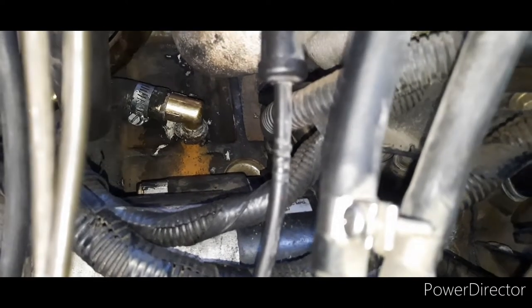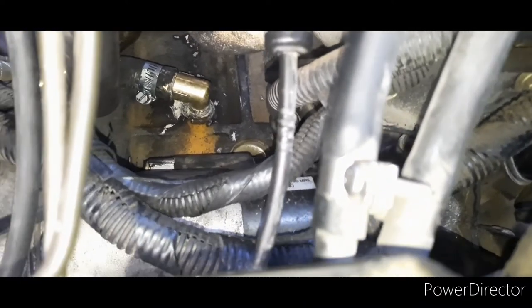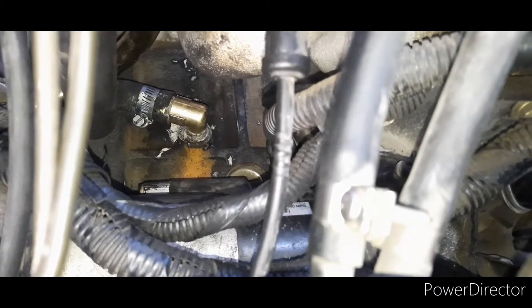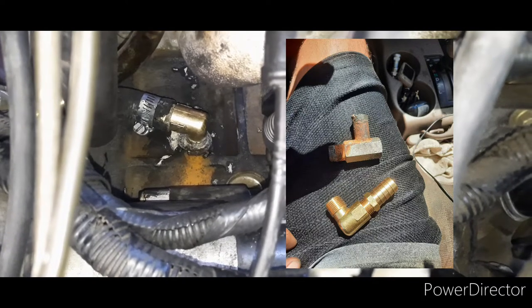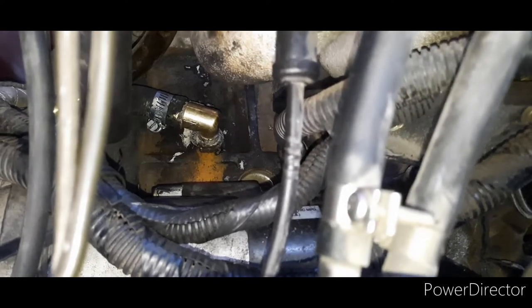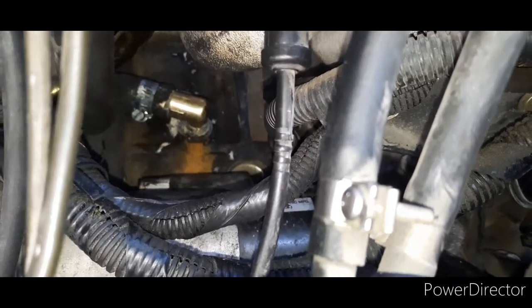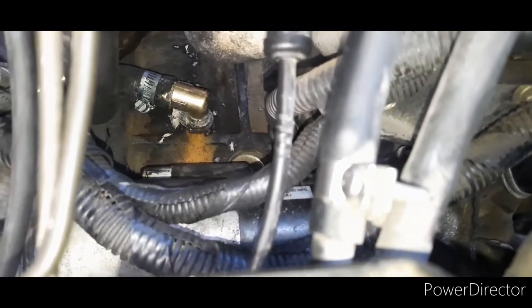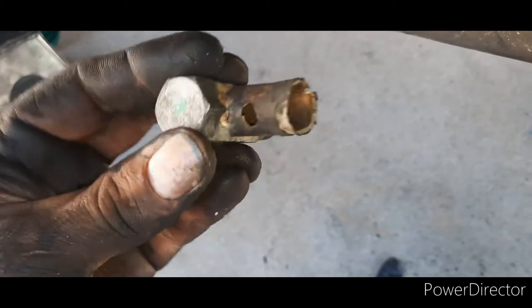You can see all the rust that leaked out — it was accumulating there from the coolant or water coming out. That rust color is because water was being used. Anyway, I ended up going to Ace Hardware and got a 3/8" elbow fitting with a 3/8" connector that would take that hose size. It essentially has a nipple and a 3/8" thread on the nipple connector, and 3/8" on the one that connects to the block. I used brass so it won't rust out.